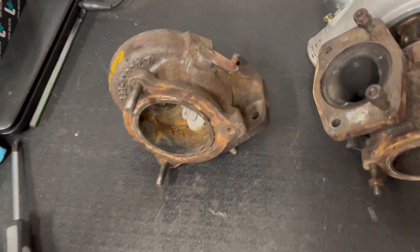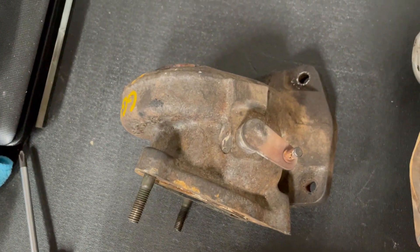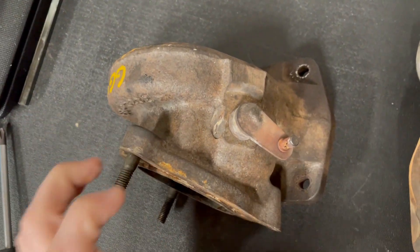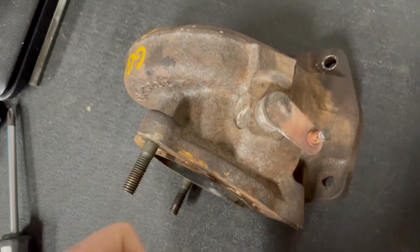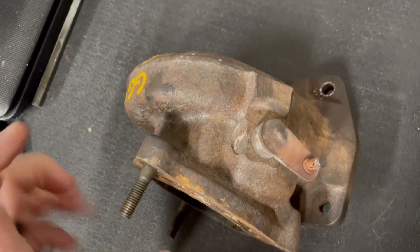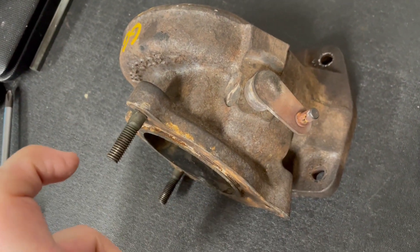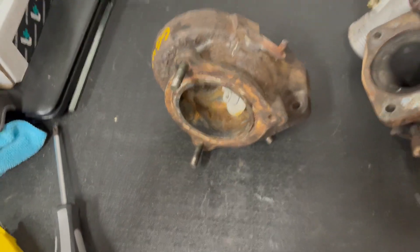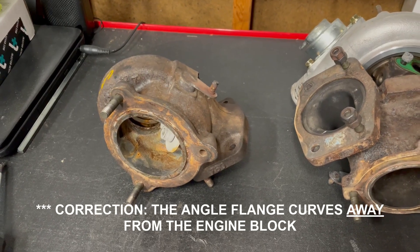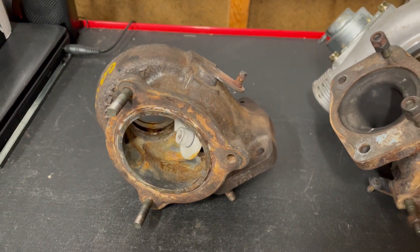If I get up high here, you'll notice that if I square this up with the actual place where it mounts to the exhaust manifold, the exhaust flange is sort of curved — it sort of curves away from it, it doesn't come straight out from it. You'll notice that this side on the right is a little bit longer than this side on the left. What this does on a Redblock is it actually pulls the downpipe towards the engine block. And so that's somewhat suboptimal in terms of clearance and fitment and fabricating a downpipe. This is the largest size opening, but it is not necessarily the easiest one to work with.